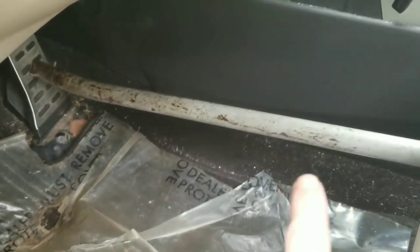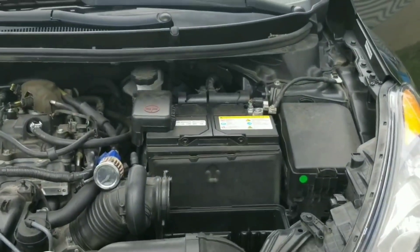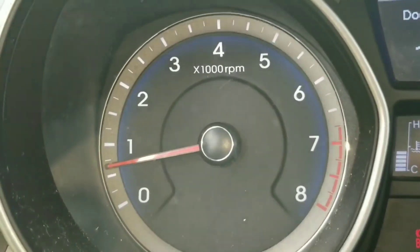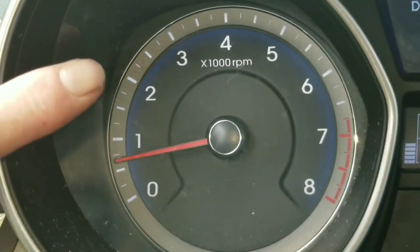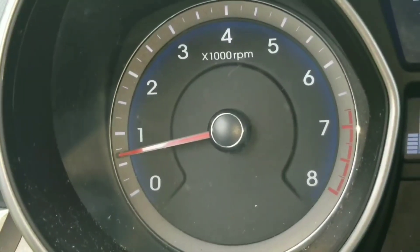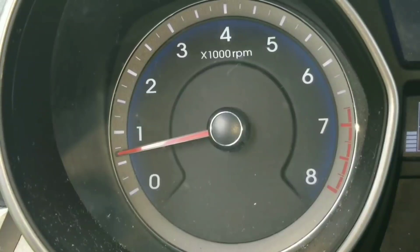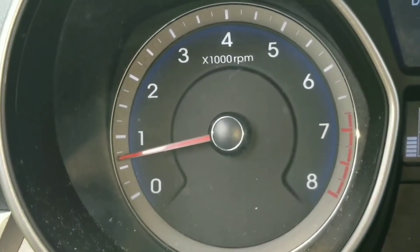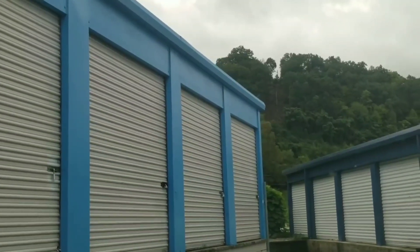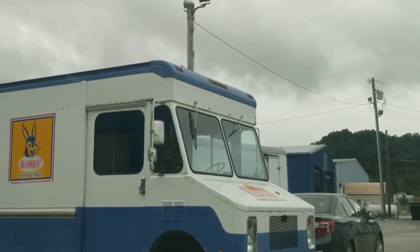Go ahead and return our idle speed to normal — take the jack handle out of there. Go ahead and insert your air filter assembly. Once you've got your RPM down and everything's put back together like your filter assembly, go ahead and shut your engine off and let it heat soak for one hour. The instructions say 15 minutes, but we're going to give it a little bit of extra time. We're going to do similar instructions to what we did with the CRC so the results aren't impacted. Once you're done letting it heat soak, let's go for a drive — and it says drive aggressively.